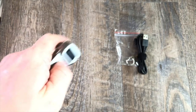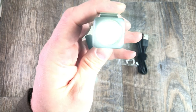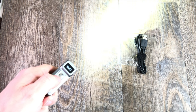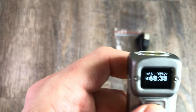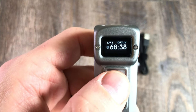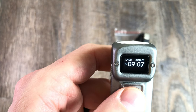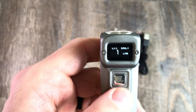So if I press and hold the mode right here, I access a thousand lumens directly — very, very cool. If I press and hold the on switch right here, that's going to direct access me into the one lumen mode. So I'm in 200 lumen mode right now, I turn it off, press and hold power to access my one lumen. Turn it off and it should now remember that I was in 200 before. That is fantastic — it's got a great memory. It's giving me the time remaining on that mode. Right now in ultra low, the one lumen, it's giving me 68 hours left in that mode. If I bump it up to 15 lumens, that's level two — 18 hours. Level three is 65 lumens and I got nine hours left. And level four, 200 lumens, I got almost three hours left. I just find that really, really cool.